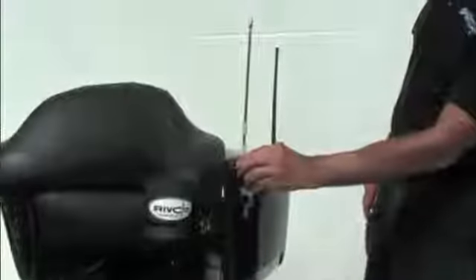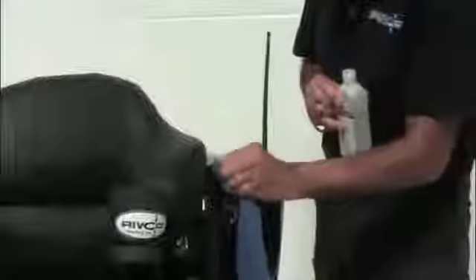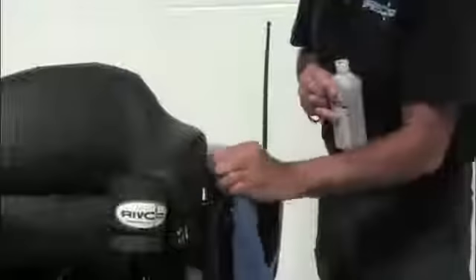As viewed to the left, I'm going to tip that back just a little bit — five, ten degrees. That's up to you, whatever angle you'd like it to be at. The next step, once you've selected a location, is to clean that spot very well with a little bit of rubbing alcohol. Take a rag — any rubbing alcohol will do. Clean the area well and remove any wax, dirt, grease, or anything like that. It'll allow that double-faced adhesive to have the best adhesion.